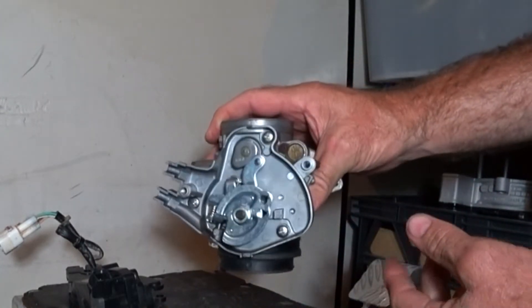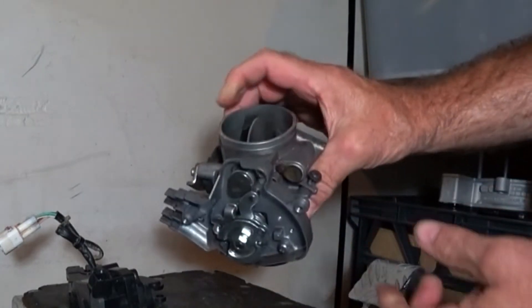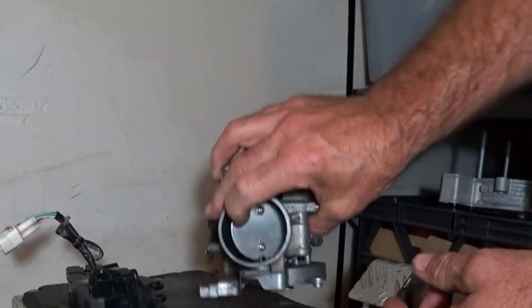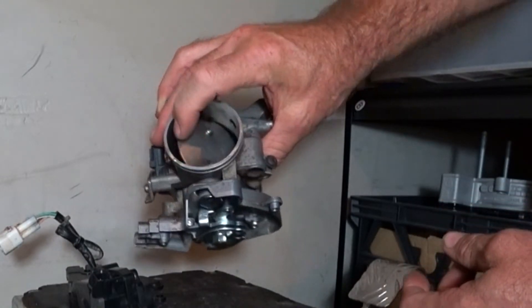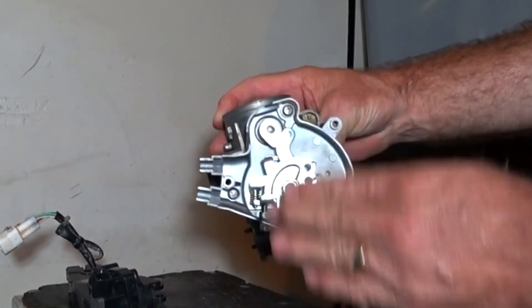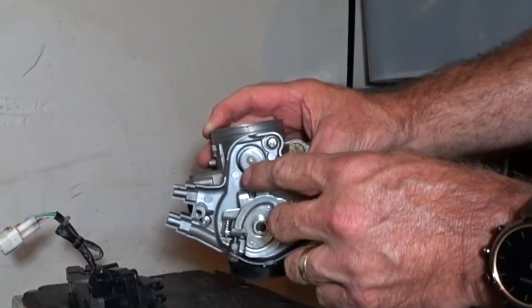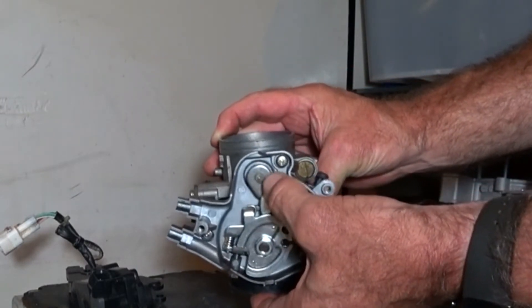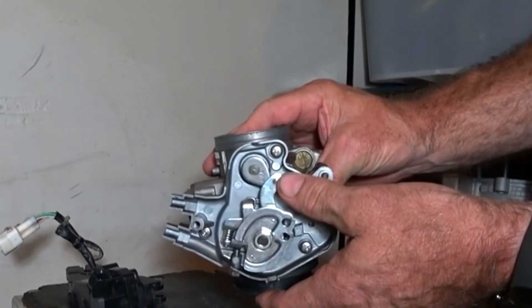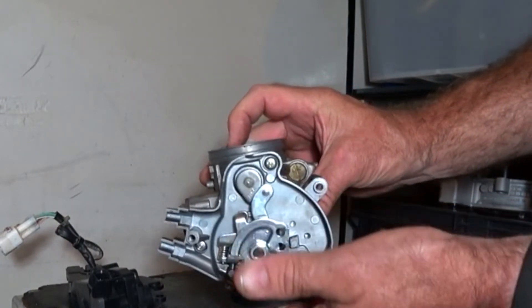So if you close the throttle you get engine braking; if you go to 100% you get full air, not waiting for a delay built into the computer for this to gradually open. I have a second video about the delays built into the system and I'll put a link in the description, where you can see that working in 240 frames per second slow-mo. You'll be able to see that this closes sometimes when the main throttle is open and does all sorts of crazy things.